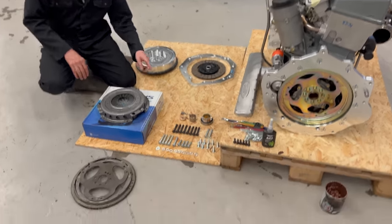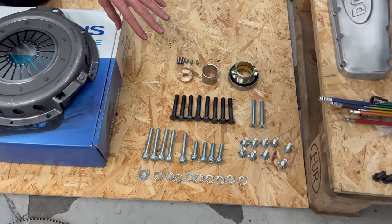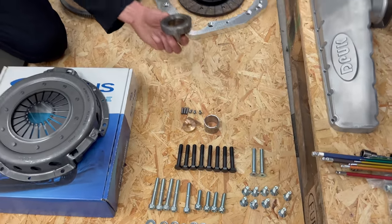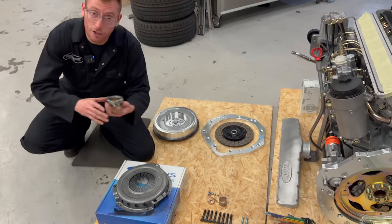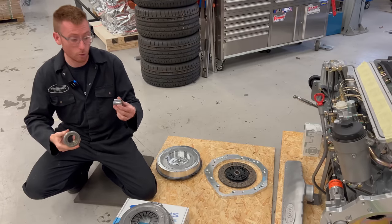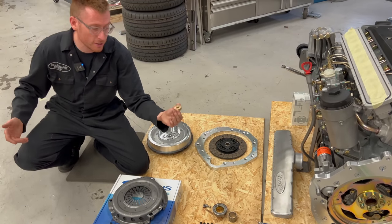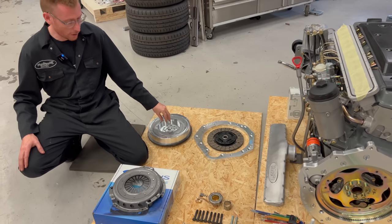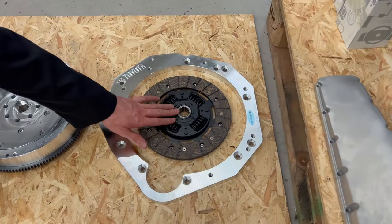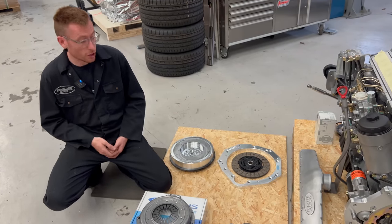Other bits included in the kit: the fixings for the flywheel are all rated 10.9 — nice and strong, well tested, Loctite as described on the rotating parts. We also have an all-steel heavy-duty release bearing and a sleeve which goes inside — that sleeve adapts it from our standard release bearing to one that fits perfectly on the Toyota shaft. You also get an oil-lite center bearing — replaceable if it ever wears — a brass-bronze oil-lite that goes into the center retained by three bolts. The dowels are for the pressure plate to mount onto the flywheel, and we also have the organic drive disc with heavy-duty springs.